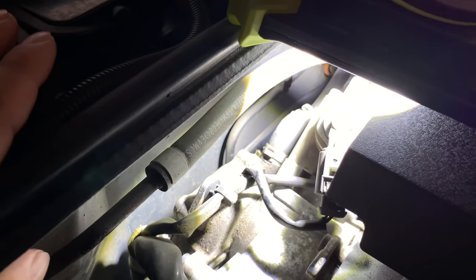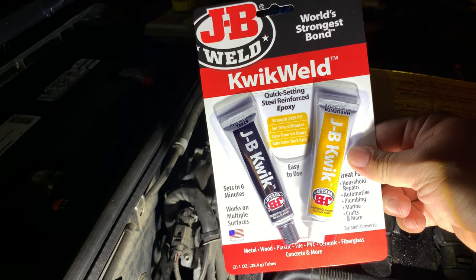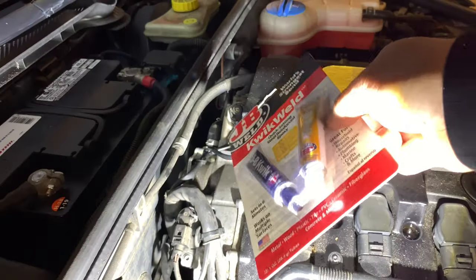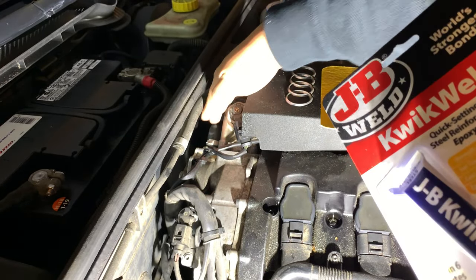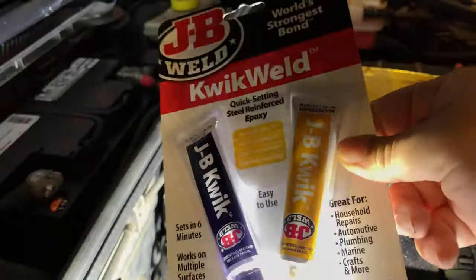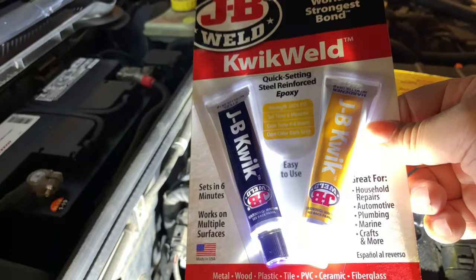When the car warms up and that o-ring warms up the noise usually goes away, which is why I haven't caught it until we've had some really cold weather. I'm going to put a little JB Weld down here, push everything down in place, leave it overnight to dry, and hopefully it goes away. If you're uncomfortable with JB welding something, the real fix is to replace the vacuum pump — and regardless you can do that anyway. The JB Weld is not going to prevent that. So I'm just back from AutoZone and what I picked up was JB Weld, which is actually recommended on the Audi forum by one of the members.